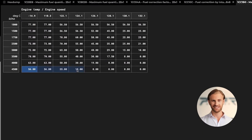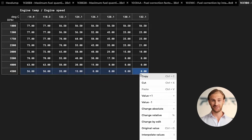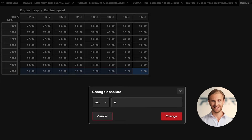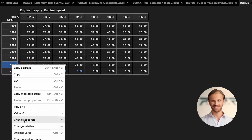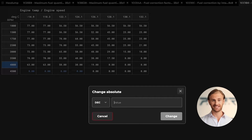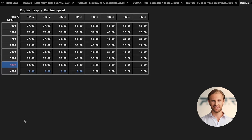Let's start here by entering a zero value — I am changing the absolute value to zero. As a next step, I am adjusting the map axis for engine speed, to make sure that our change will be applied in the desired range. I would like to set it to 4499 RPM. This will give us behavior where, when the engine speed crosses the entered value, the fuel will be cut, making the expected popcorn limiter.